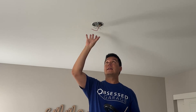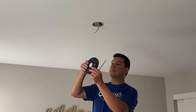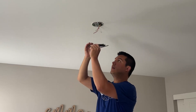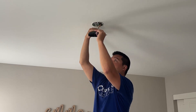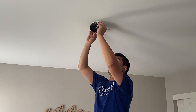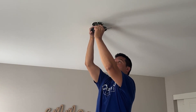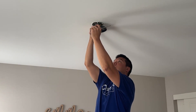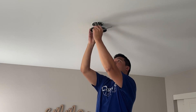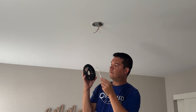If you've got an existing light, go ahead and take that off, which I've already done. Next, we'll take this base plate for the fan, route our wires through, and use the screws that are already up here to screw it into place. There's some adjustability in terms of where we want to mount the screw — there are four little mounting areas.